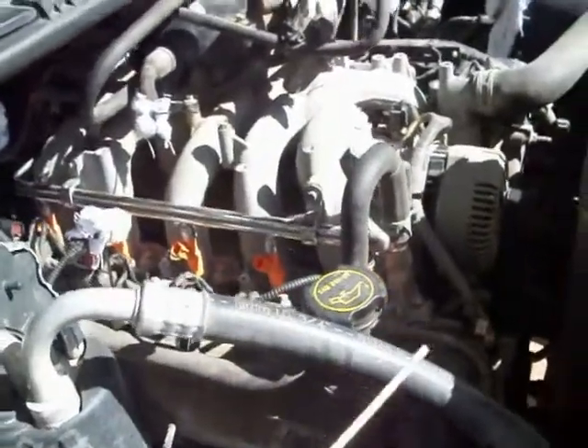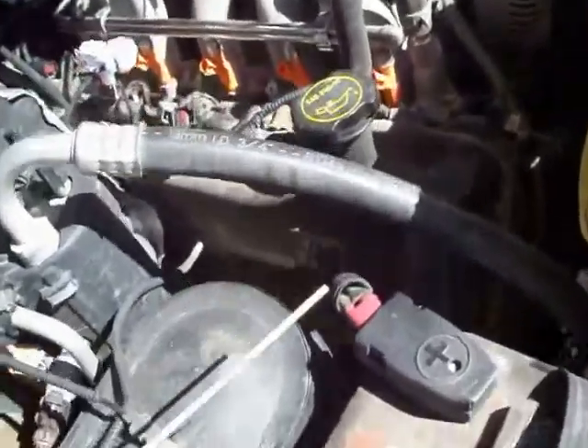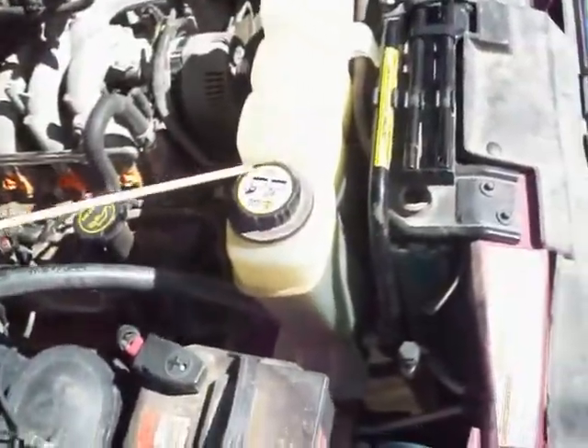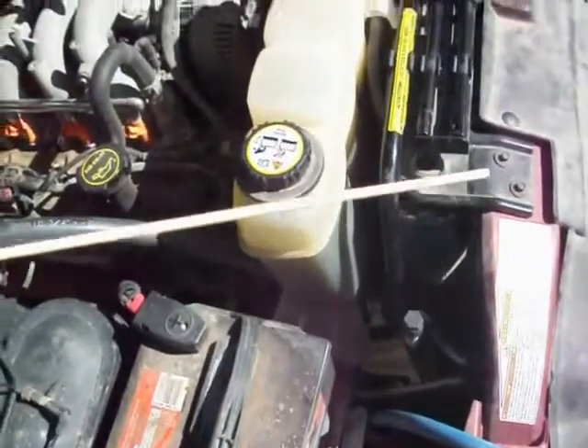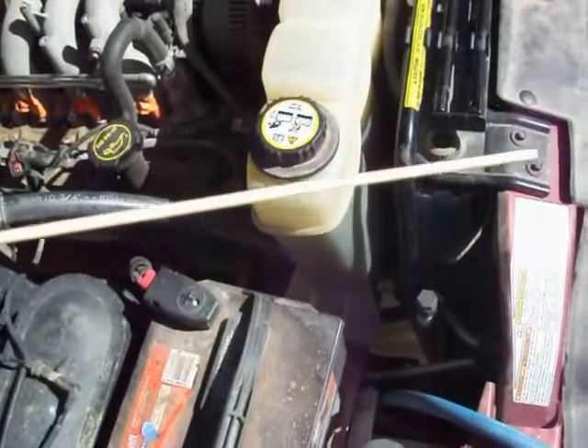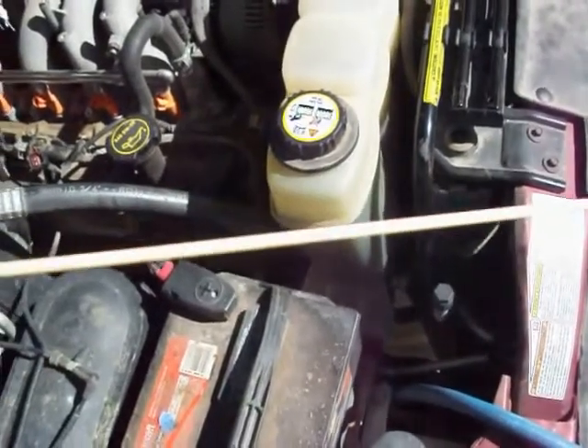We decided that the valves are closed because I just did the air test where I pressurized the cylinder through the spark plug hole and it holds pressure — I believe the valves are closed. Next step is to find out if the piston is down so that when we run the tool in, the tap and reamers don't hit the top of the piston. I'm going to take this bamboo skewer — using bamboo or wood or a chopstick, something non-metal, so that if there's a valve in the way I don't bump it, nick it, or chip it.